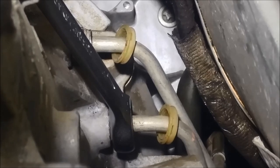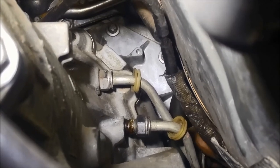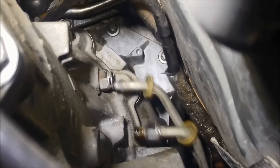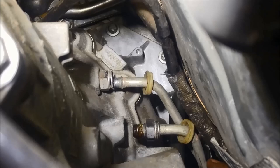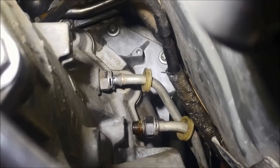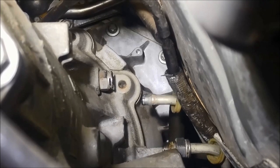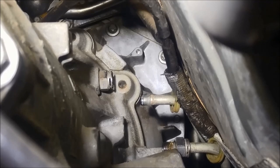Using an 18mm pipe spanner, just loosen it. With the bottom one off the top one should just pop out. It's important not to bend the cooling lines as there's not much room. Wriggle out the filler tube. All we've got left now are the bell housing bolts - note that some bolts actually go from the front backwards, so make sure you take those off as well, including the one above the power steering rack.